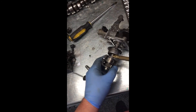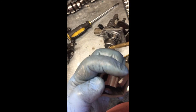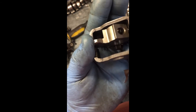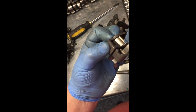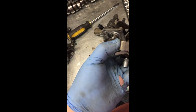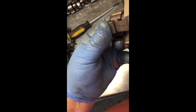I've got the two springs on over the shaft with a washer underneath the cup. There's a spring, then a tab on the bottom, another tab on the other side. Moving it upside down, there are two big pins and a longer pin that straddles across. While holding these two parts under some spring tension, I stick my extension in here just to hold it so it doesn't pop out, and then I slide it over the shaft.